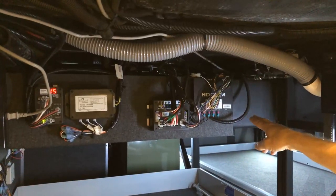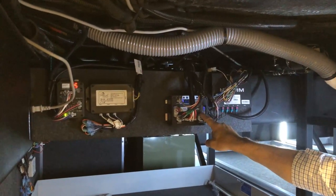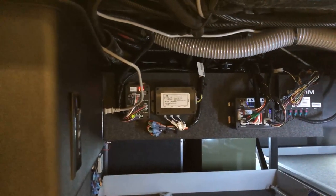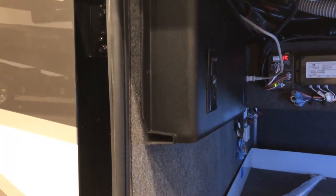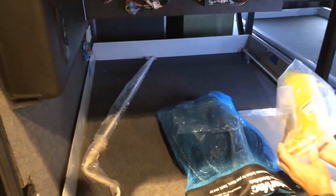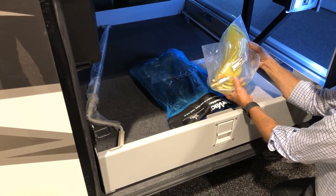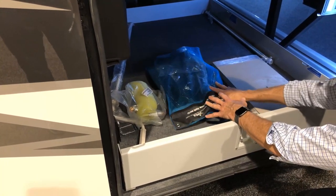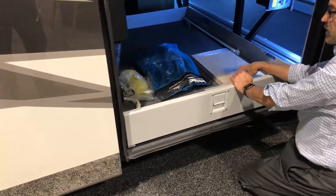Just beside the sync cylinder is the camera module with all cameras labeled for their corresponding plugs. This is our dual motor control for our other slide out. We have a Silverleaf module here — the TM229 — and our bedroom slide out control. There are additional 120-volt outlets here. In the tray we have our awning rod for opening and closing, an auxiliary air supply for front or rear coach connection, our Intervac accessory bag, and additional floor tile in the same lot number and color as your current floor.